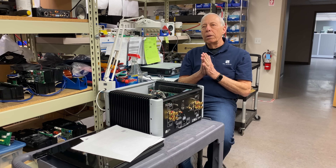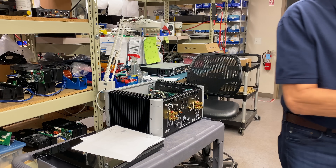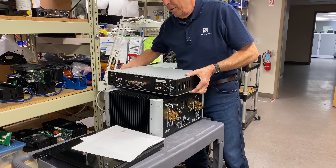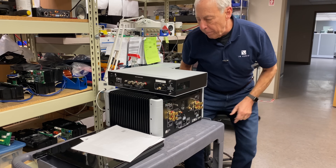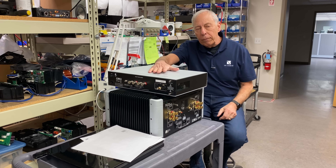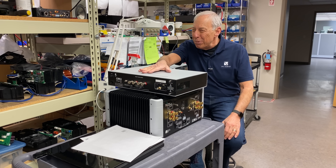Compare that to one of our Stellar series. So a Stellar amplifier — this is our newest amplifier. This beauty is a 1200 watt amplifier called the M1200. It's a monoblock amplifier that outputs 1200 watts. But because it is a MOSFET class D design with a class D switch mode power supply, this runs at just about 90% efficiency.